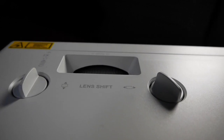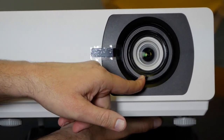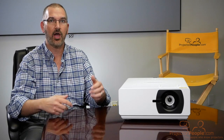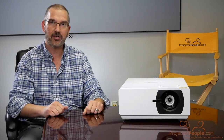This is 5,000 lumen laser DLP as I mentioned. It's 1000:1 contrast. It has fine vertical and horizontal lens shift for installation flexibility, and then a nice 1.65x optical zoom. You have the ability to manage the focus from the top, and this thing connects to Crestron and AMX. So if you have room messaging systems or emergency messaging, it's going to plug in there. You can also monitor the device and do things like turn on and turn off at certain times. With the laser, you can also keep this thing running almost around the clock without it overheating like a lamp-based unit would.